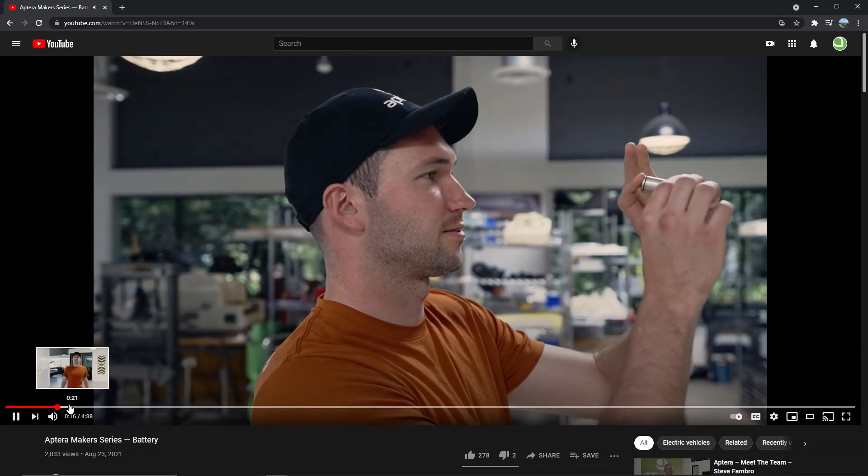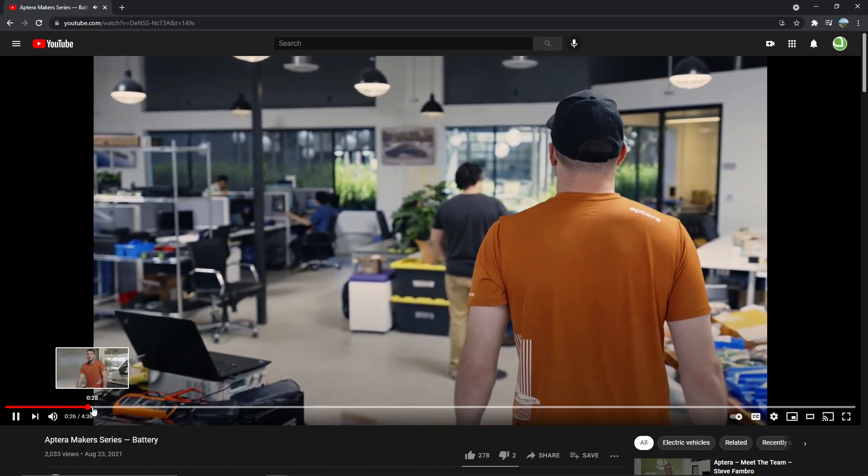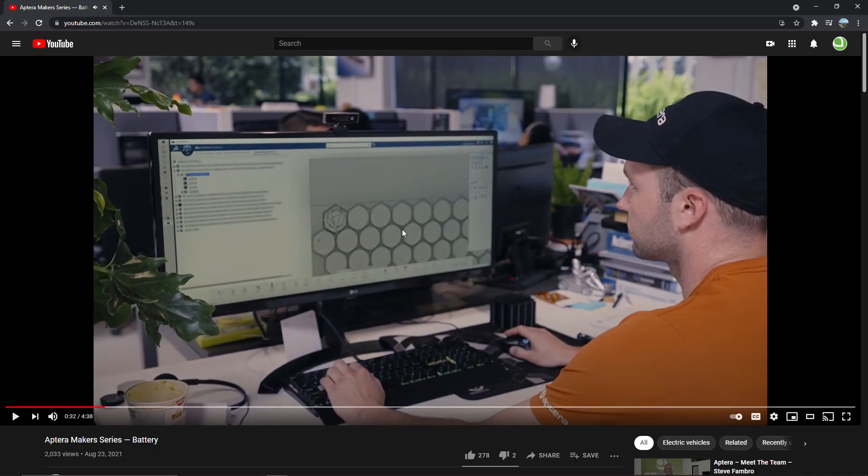They're going to see other designs and architecting their whole battery system for the whole car. The biggest challenge is really trying to pack everything into such a small space and still deliver on all the other things like high temperature and low temperature performance. It looks like they're using cylindrical cells in a honeycomb pattern, and he looks like he's designing the battery casing. The battery casing doesn't have to be a structural element because it will be placed within the composite shell, so it doesn't need to be as rigid.